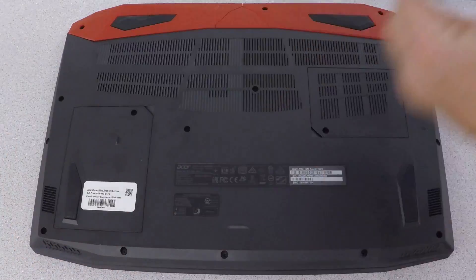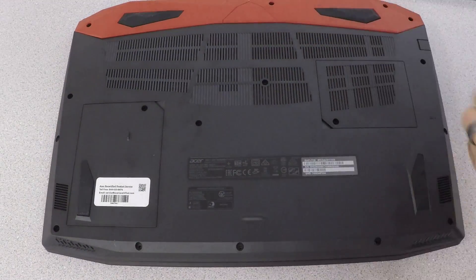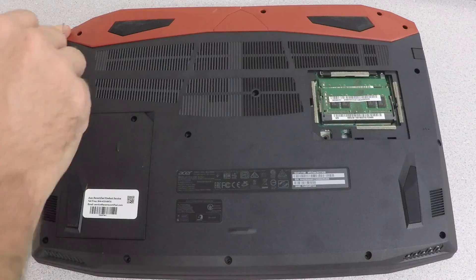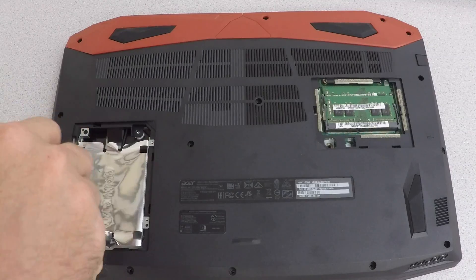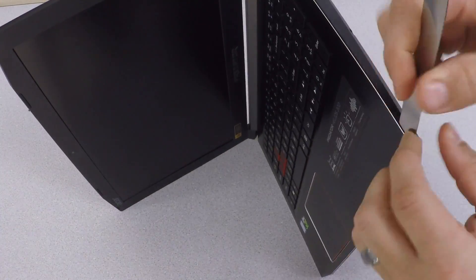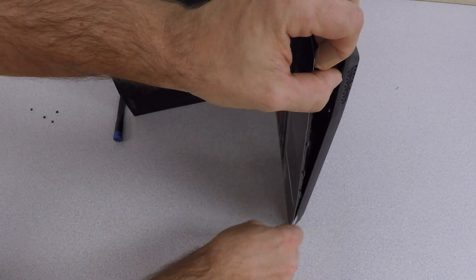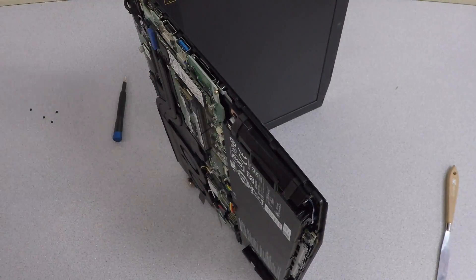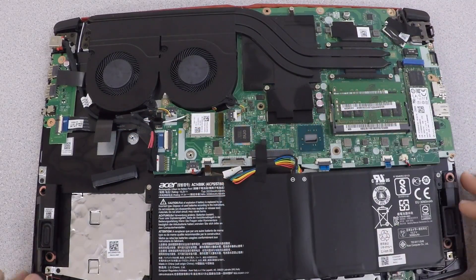The screws on the back are just normal Phillips head screws. Take your time and remove all of them — they're all the same size so you don't have to worry about mixing them up. I do take out the hard drive tray as a precaution, but you don't really need to do that. Take your edge and pry tool and work on the side and front first to separate the back plate — it's really easy doing it this way. Please don't forget to remove the battery cable first — that is very important.